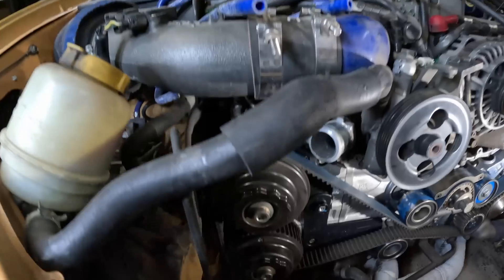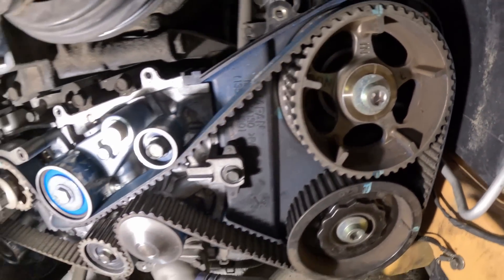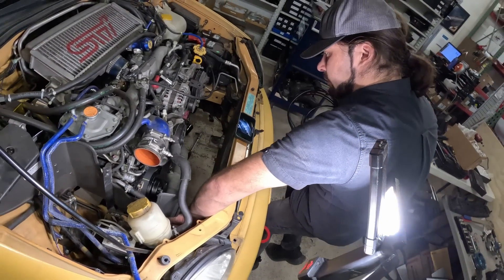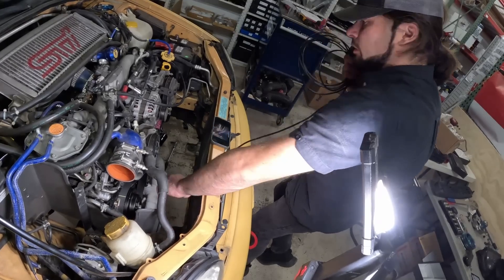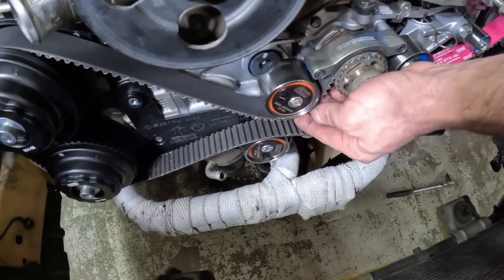So here's where we're at. We've got the crank pulley off. I mentioned that I had checked my timing and knew the timing marks were a little bit off — things may have changed. Let me get you a close-up of those timing marks. On the passenger side we're okay, but on the driver's side it's kind of worse. Definitely good that we've got the eccentric pulleys to try and dial this out. There's a lot of slack in the belt right now, but that's because the eccentric idlers are both completely loose, so there's a lot of extra slack in the belt at the moment — this is not tensioning it yet.